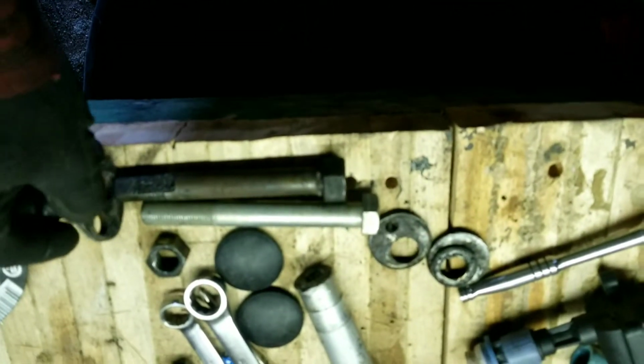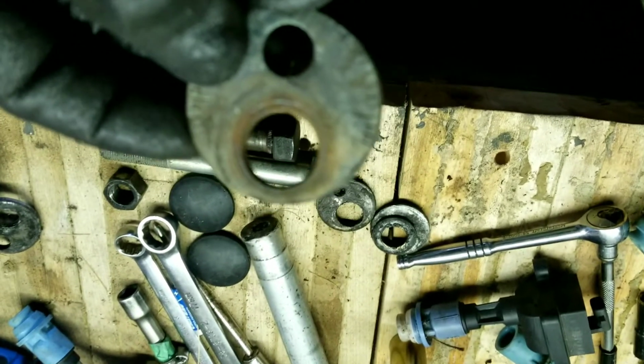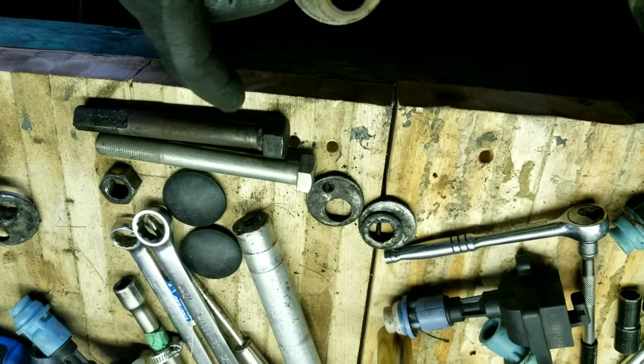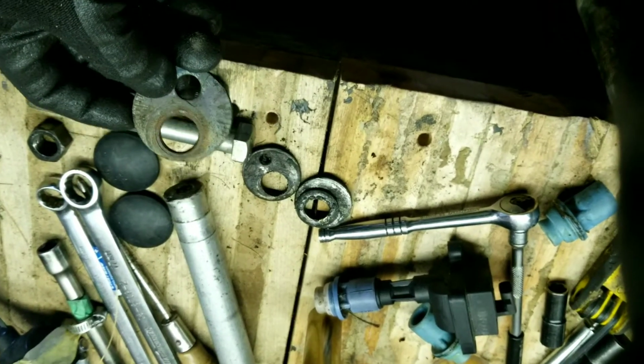One thing to note, here's your Toyota bolt with its camber adjustment. So this one here goes on the back onto that. This one here goes onto the back side. This one here has a splined, hard to see. You can see it actually through it right there. It's splined so that the washer can do what it's got to do to get your camber negative or positive. Since I have an obscene amount of negative camber for my liking, I'm just going to shove them in there as far as I can and then lock them down.